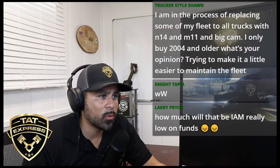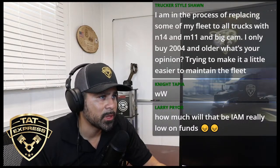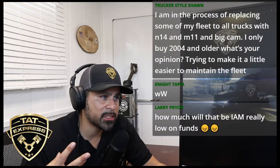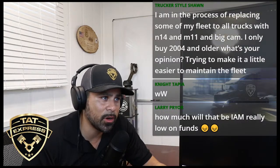Does the EGR corrode internally? The EGR can corrode. A lot of times what I see with EGRs is they get built up with a lot of soot. And this is why the video that I released last week about the 300K mile ash cleaning, that's getting your eyes on those EGR coolers.